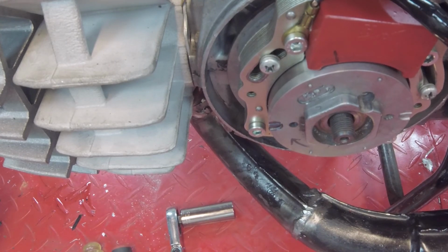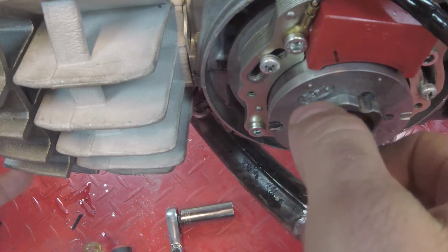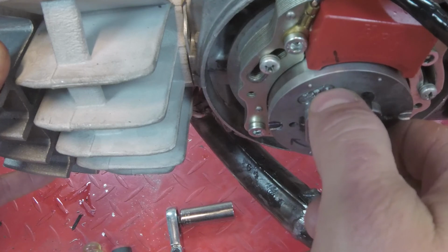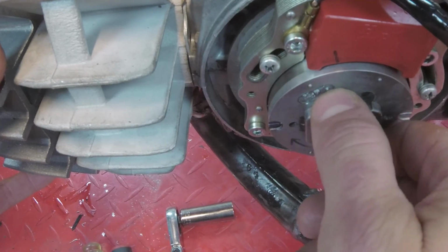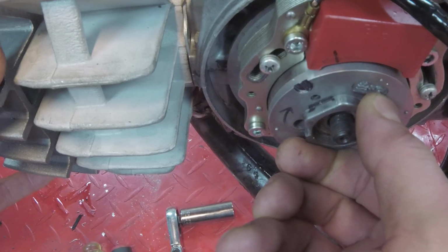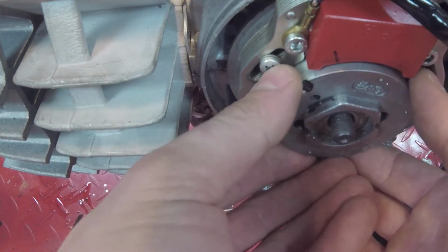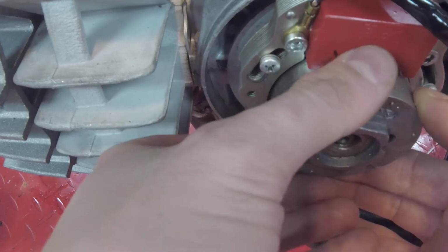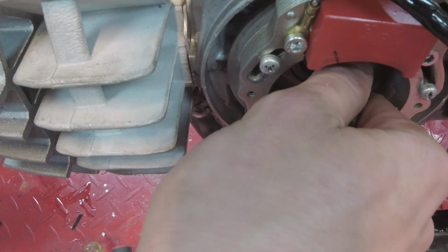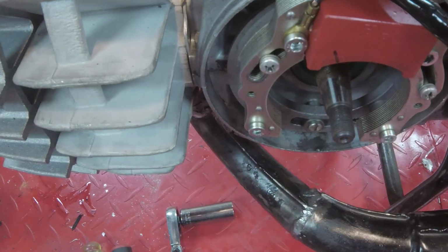Now I'm going to crank it in the same direction of the motor until the piston hits our stop, which is theoretically 2 millimeters before top dead center. Hit it. I'm going to take this off, snug it by hand, make sure I'm against it. Against it. I'm going to take our little mark, line it up with the little 10 spot on here I've got marked.